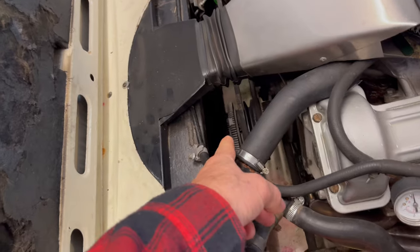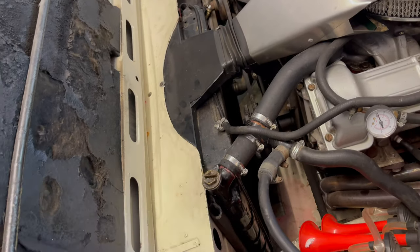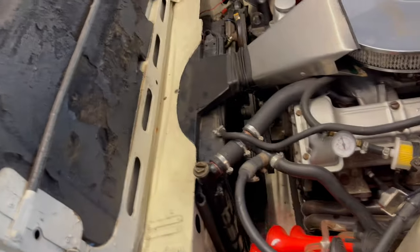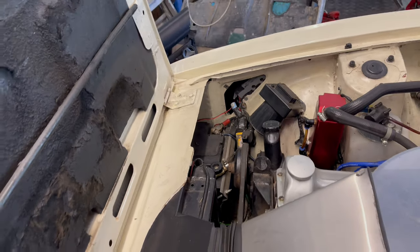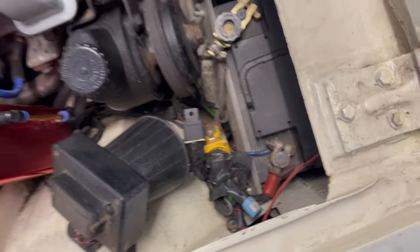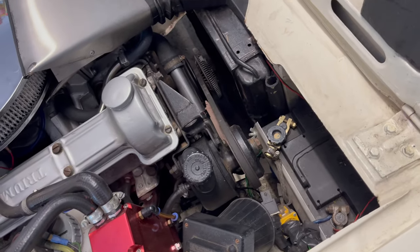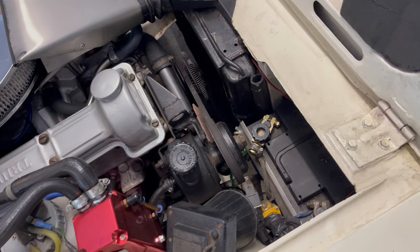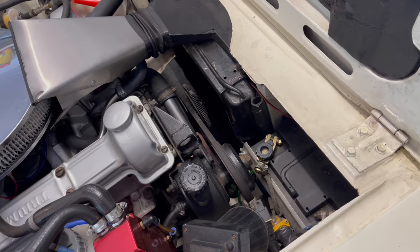This engine never overheats — it hasn't got the original fan. I took the fan off and instead, from a scrap yard, fitted two-speed fans on the other side of the radiator, I think from a Volvo 340. I put on an electronic thermostatic control with a little sensor stuck onto the radiator covered with hybrid polymer sealant, going to a little electronic circuit I designed that controls both speeds. At normal temperatures just the single speed comes on, which is all I ever hear working.